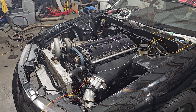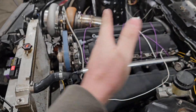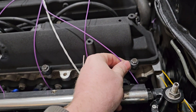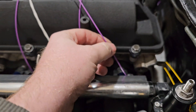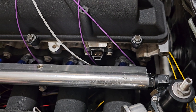Doing a wiring harness is no fast job, guys — this takes a long time. A lot of planning and prep. Now that I've got all the wires pulled out and spread apart so everything is going in the direction it's going to go, I am going to go one by one and snip them to about the length that I want. This right here is pulled tight — I've got my harness pulled all the way up to where I would want it to be so I can service it if I have to. You don't want to cut it down here where the connector is — you want to cut it up a little bit to give yourself some room. It's okay for the harness to slack a little bit; it's not going to drag on the ground.